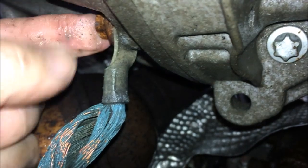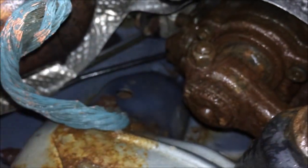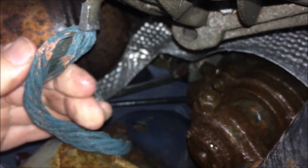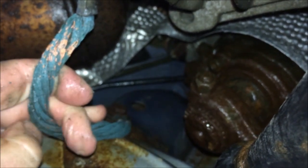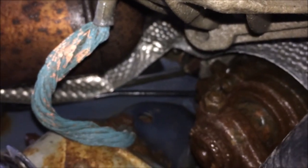So in this case, just disconnect it right here — it's right at the transmission. It doesn't go very far, just about 10 inches from my thumb to my finger. That's it. If you're having all sorts of electrical issues and you can't figure it out, get underneath and have a look. This car had a kill switch placed on the battery, and if they had just come down here and taken a quick peek — look at that. A quick change, not going to cost much, couple of bucks at the store, and it'll save you a lot of headaches.